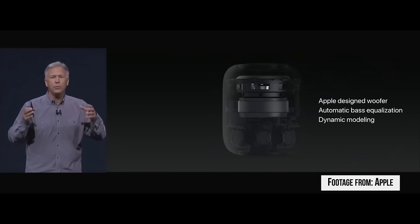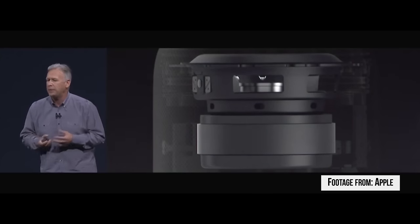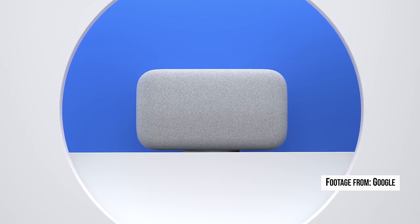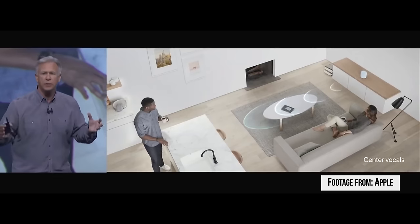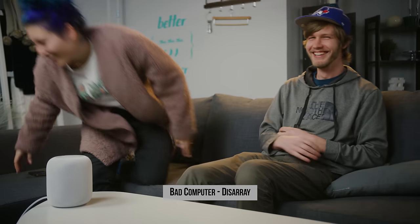There is more to this technology than just using good speakers. Both HomePod and Google Home Max use special low-frequency calibration microphones to give themselves spatial awareness. This functionality allows these devices to map the room around them and then apply automatic bass correction to increase clarity. Apple said in their keynote that the HomePod would direct certain musical assets like main vocals to the center of the room, and ambient sounds and backup vocals to the side — which is really good news, because otherwise an omni-directional wired speaker would not be ideal a lot of the time.